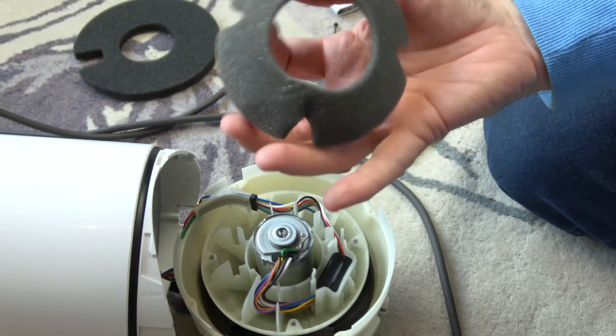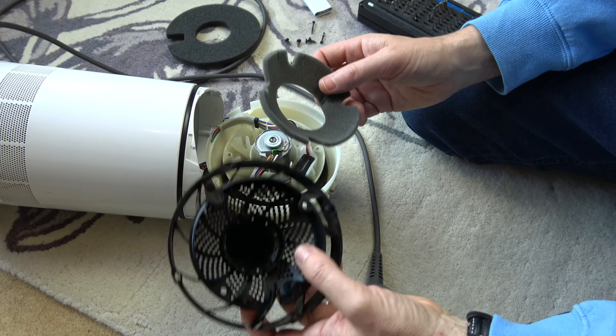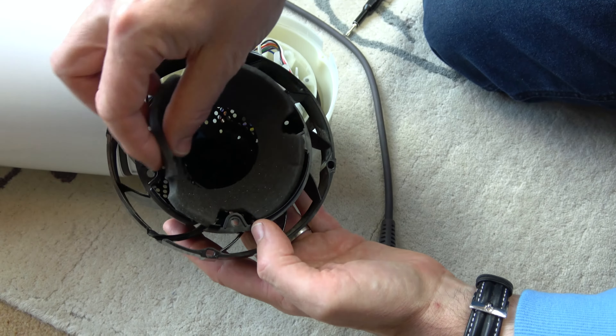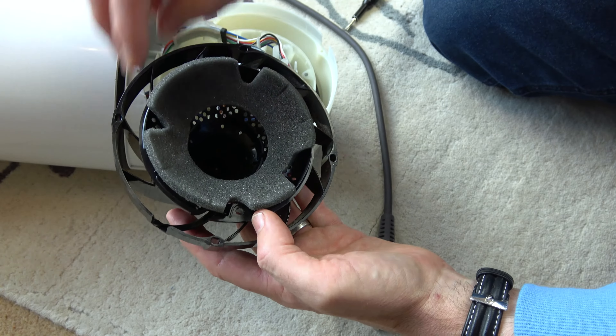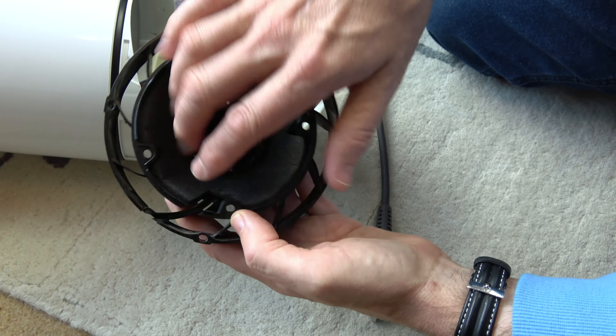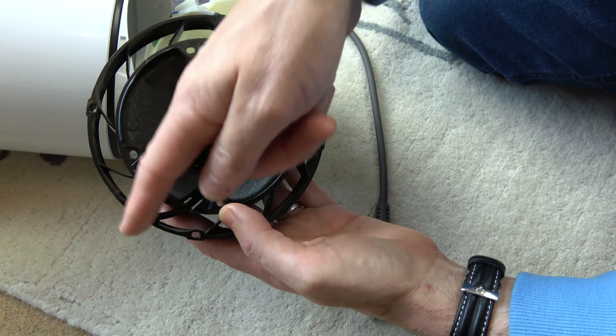The other filter is located in here. It's really important that you clean deep down inside here — you can see where all the vents come through; this is where it sucks in air from the room. Make sure all of these vents are really clean because you will get dust build-up on the outside and inside, and if they're all blocked you won't have good airflow. Use a cloth that's very slightly damp — not wet — and clean all in here. Remember there's a circuit board at the bottom, so do not get water down there.